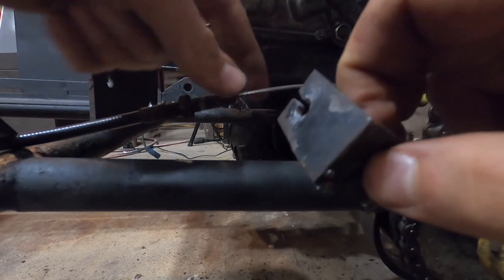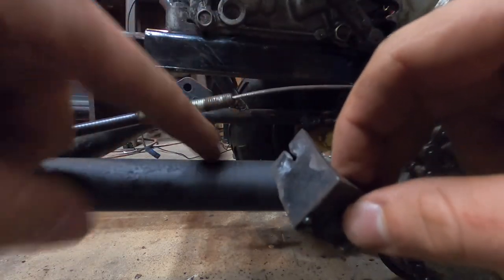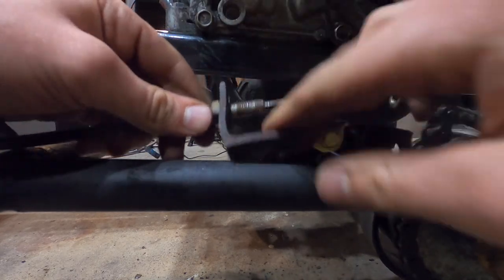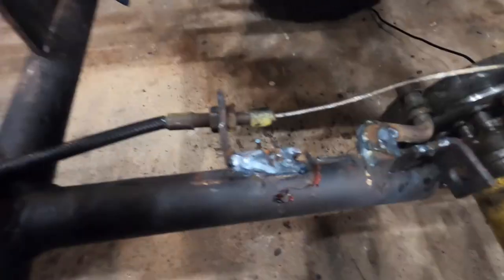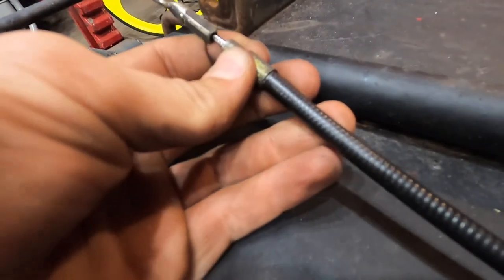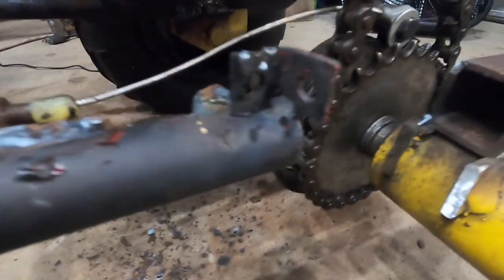I made this little bracket here, so I'm gonna use this to hold the brake cable in place. I'm gonna go ahead and put it on and then we'll weld it on to the frame. I just welded this bracket on which holds the cable for the brake. You can see the cable goes under here all the way to the front. Before I bolt this up to the pedal, I need a bracket to hold back the outer casing. So I'm gonna go ahead and chop this little bracket off here from the back and then weld it on to the front area so we can reuse it.